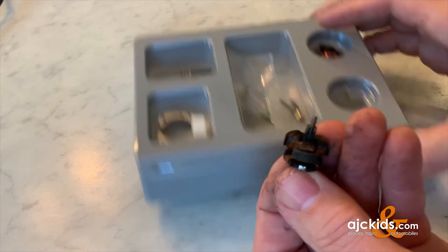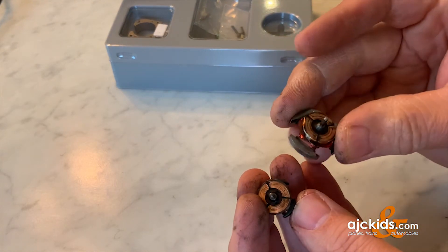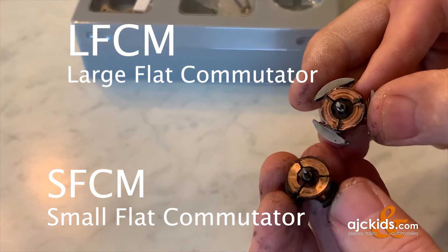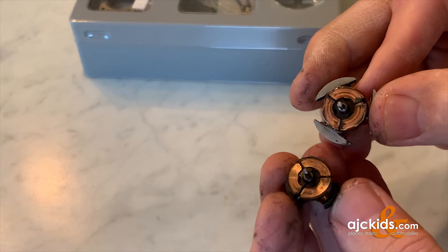The armature that will be replaced is this one — you can tell why my fingers are so dirty; it is the carbon from this armature. It is a small flat commutator armature. In my right hand I have a large flat commutator armature. You can clearly see the difference: the commutators or brush plates are both the same size, but for the large flat commutator motor the 3 poles are much larger than the commutator. On the small flat commutator motor, the armature is about as big or only slightly larger than the commutator. You see 3 copper plates because it is a 3 pole motor, and the brushes push against those copper plates — that is why you see the grooves and the carbon build-up on the corners of these grooves.